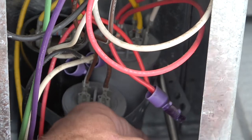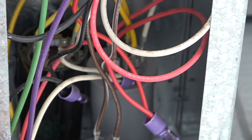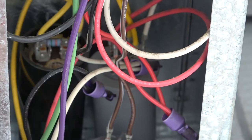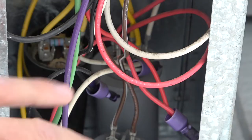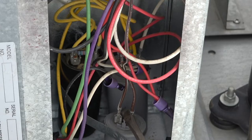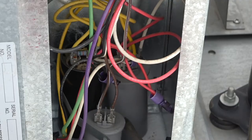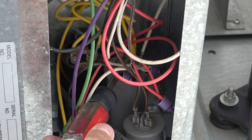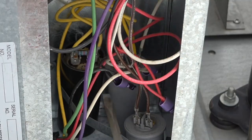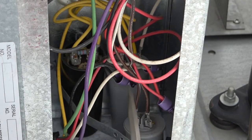Back the screw out and that's going to let these capacitors go. Now you want to be very careful not to touch the contacts — and actually you could do this first. Use a screwdriver with a good handle on it so you're not going to get shocked, and just cross the contacts of each of the capacitors. I'm going to cross the run capacitor first — just make sure. I haven't had this hooked up to power for a couple of days so we should be good, but we're just going to make sure they're all drained out. Just use that screwdriver and make sure you don't touch the metal part of the screwdriver. And then we have this big one, our start capacitor back here, and we're good.